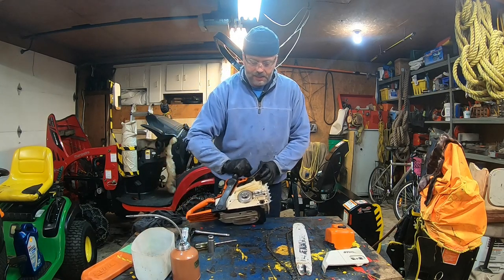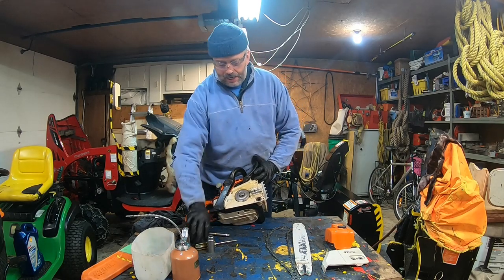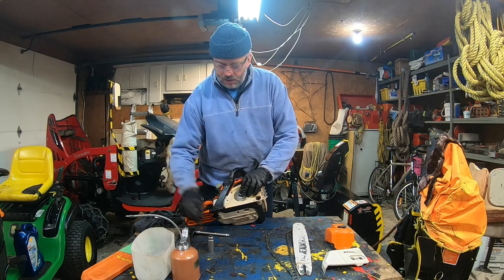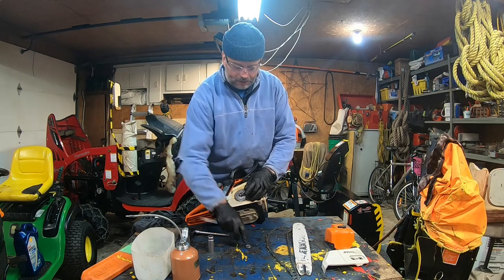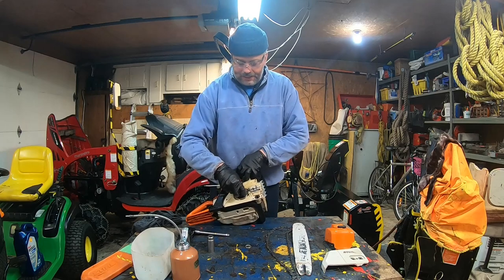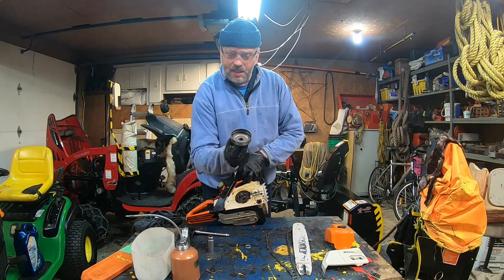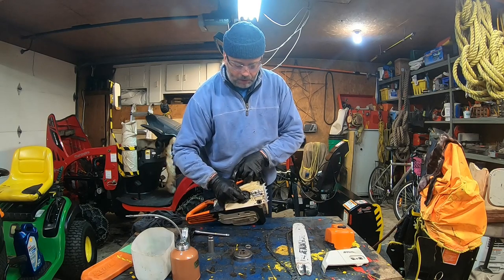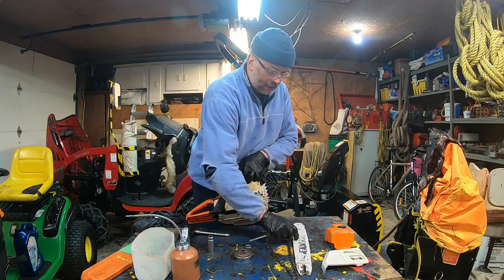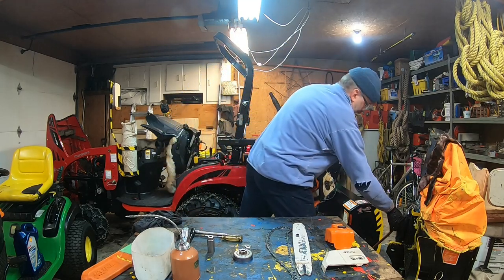All right. I know last summer I did a video because I was catching a lot of sand when I had that free firewood. Remember that German Shepherd? So I'm just going to remove the circlip here, put the clutch there, remove the brake end, that will help, and then remove the bearing. I had a little bit of dust, but it's not so dirty, I only used it for one day. Then carefully I'm going to remove the bearing and put it in a clean place. And all around here, again, I'm going to use the air pressure.